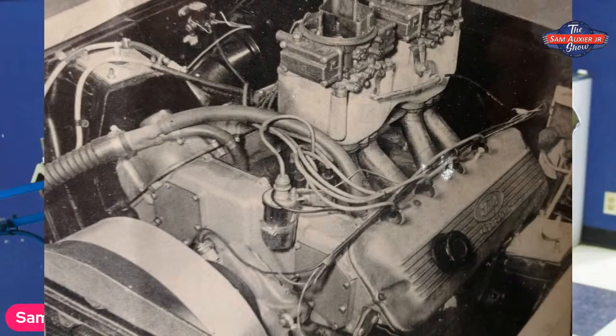The other part of this deal, let me see if I got some pictures here. Oh, okay, I got one here. This one you'll find very interesting. There are no more of them, as far as I know. But this is actually a picture in my '71 Mustang Pro Stock car. This manifold absolutely brought the car to life. I mean, this was a game changer. And Vic Edelbrock made this intake for us. What you see there is steel tubing, and underneath here is a plate. And this is a big block Chevy plenum. And those are 780 Ford carburetors.